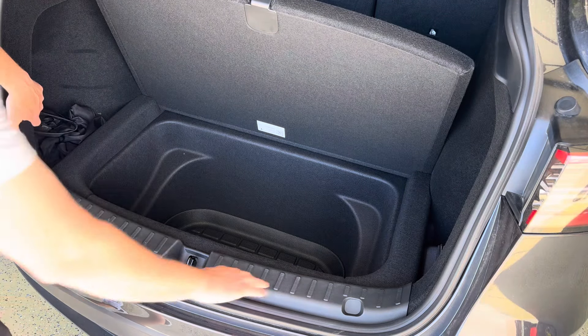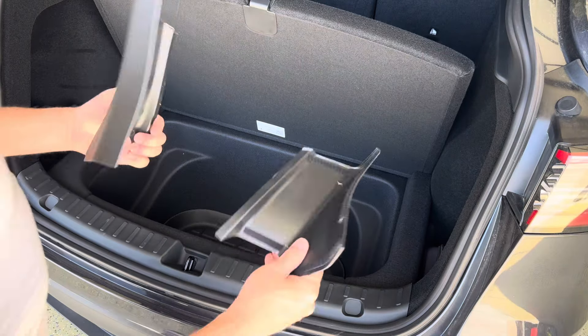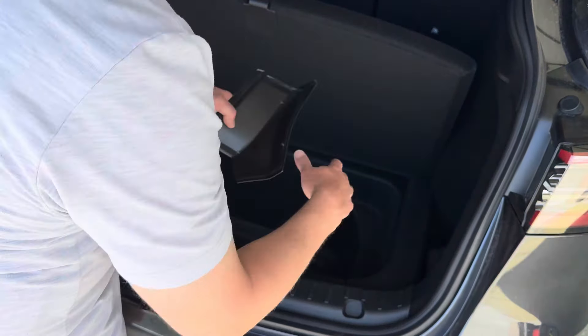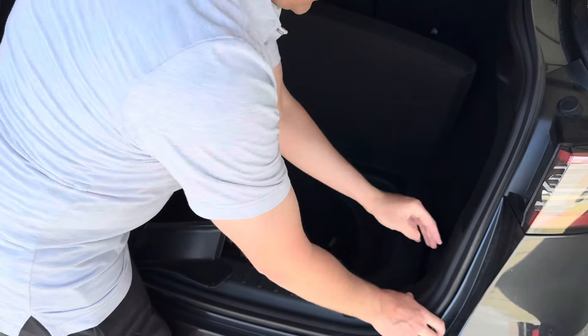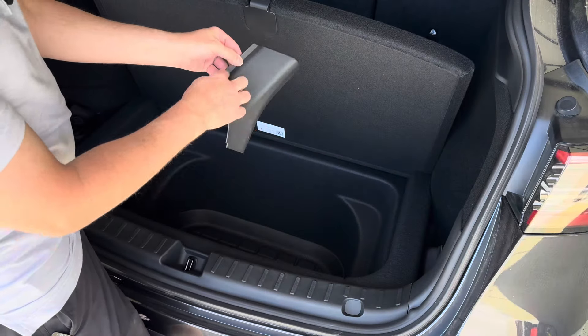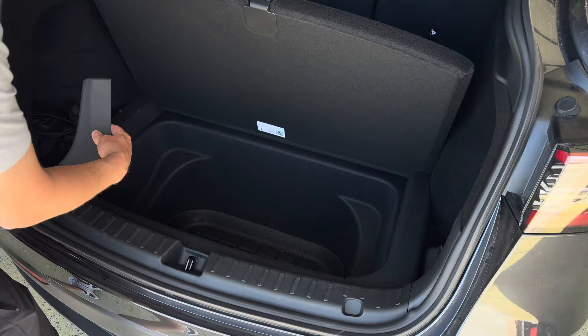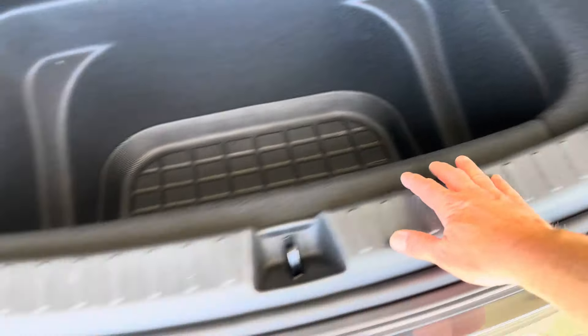Now that's down with the weather stripping over the lip. There are two pieces that go on the side to help protect the carpeted area. These pieces just have velcro on the back, and the carpet is really receptive to velcro, so they velcro right on. The lip goes right behind the weather stripping — press it down really well. Those are our trunk seal pieces.